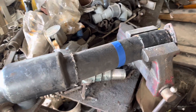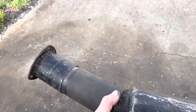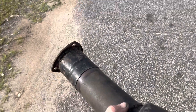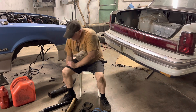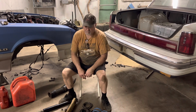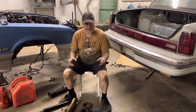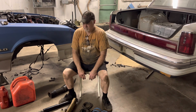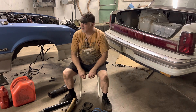ADHD kicked in again. I saw the muffler hanging on there and said, oh man, we got to cut that and shorten it up a little bit. I'm not going to show you guys what's fixing to happen, but you know what's fixing to happen. We just got to figure out where it goes, tack it in, clean all that up, put something that looks like a weld on it — then at least the exhaust will be done. We got this kind of tacked. It's not going to look perfect, but in all honesty, it's a temporary measure until we put the other motor in at some point. This is never meant to be the final product of the exhaust — it's always just meant to be temporary. I'll take that home and clean it up on the wire wheel, finish weld it, and we'll be ready to bolt it on.